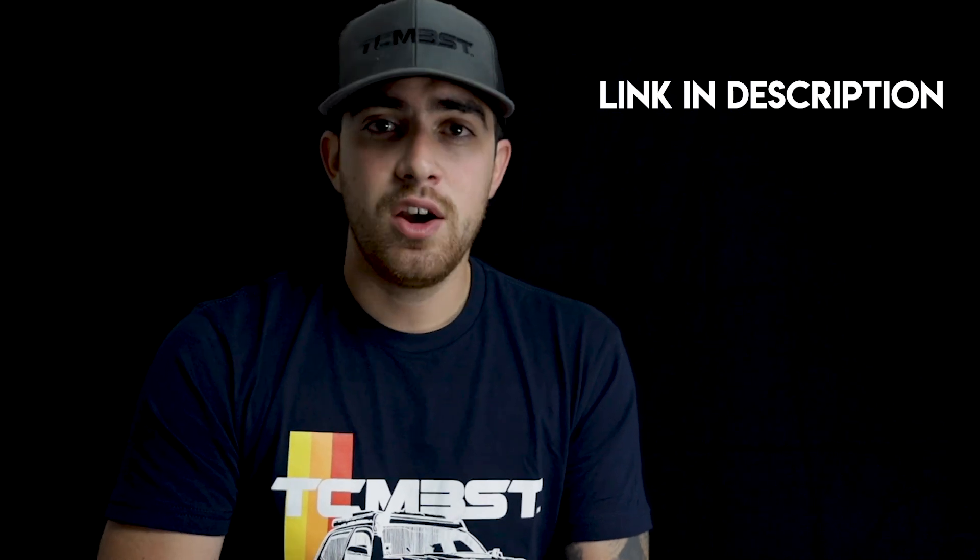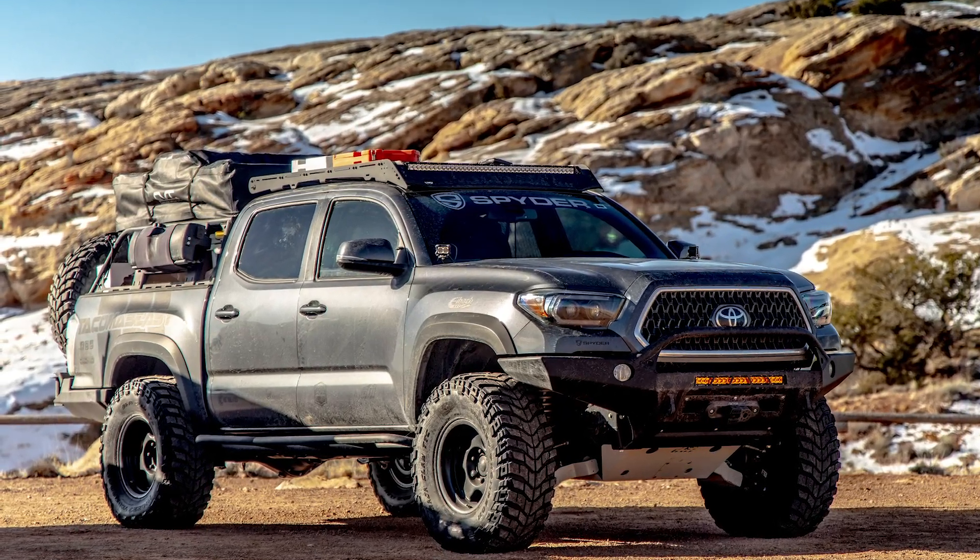Deaver Springs offers three stages: Stage One Expedition Series handles zero to 300 pounds, Stage Two handles 400 to 600 pounds, and Stage Three handles 700 to 1,000 pounds. The leaf springs we installed in this video were the Deaver Expedition Series Stage Three. At the beginning of the year we went with Stage Two because we miscalculated how much weight we were going to add — we didn't account for the deck system, everything that goes inside it, or all the camera gear. It's really easy to miscalculate, and you do have to plan ahead where you're taking your build.